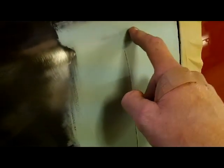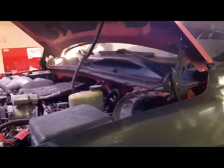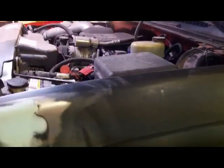There was actually a high spot here and a low spot here when I blocked it, so I put a wipe on that. And there's a spot here that I didn't know was as big as it was. It goes from this body line probably all the way down to there. But it's very minor. It's not deep. So again, we're not pulling it. We're just filling it. It's so tiny. And got a few little ripples in here, but nothing to speak of. I think the primer will make that block out so it's not wavy.